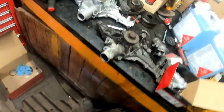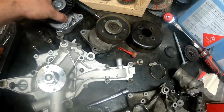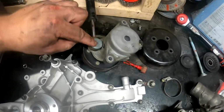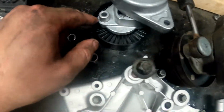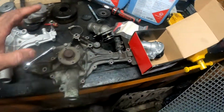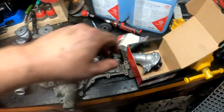So now let's continue. Here you need to re-thread, so you have to make threads there. Let me see, those bolts go through. Here I don't have to thread anything, but in order to put this strut back, I am quite sure that I have to make threads into here. Okay, so I start making threads. I'm going to use this same old bolt, just threading it in back and forth.